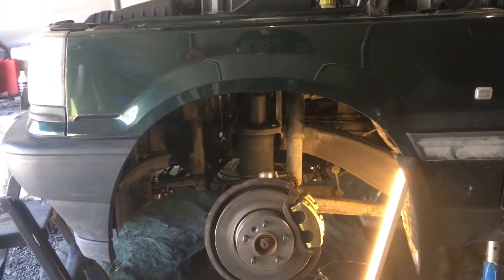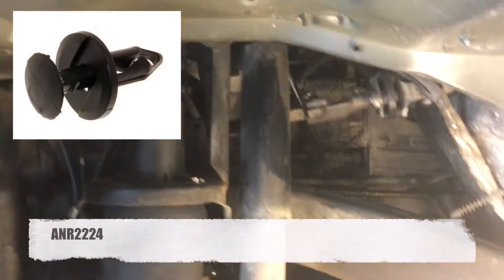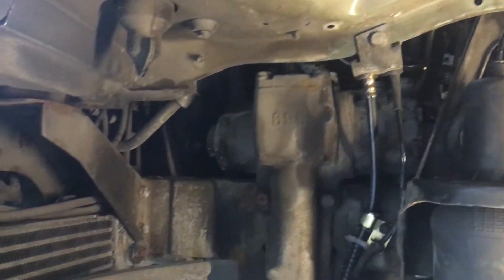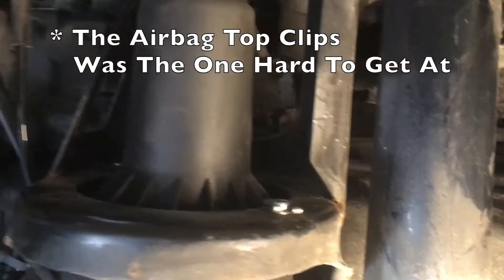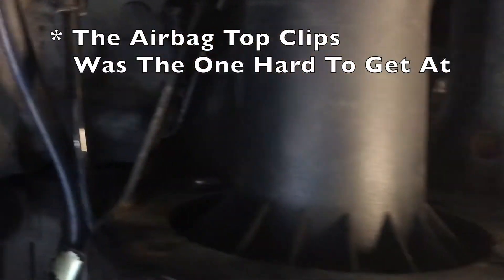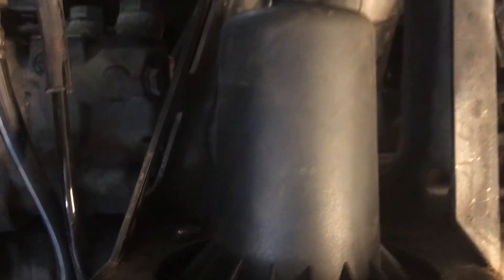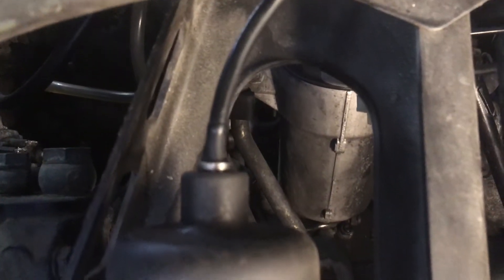As you can see, I took off the wheel lining — the plastic cover. There are just five clips holding it in place. That makes access to the airbag much, much easier and I recommend it. What I had trouble with was getting these clips out and especially back in, especially this one. Those two clips need to be removed before you can remove the airbag. I also had some issues with my air hose on the new airbag, so taking off the wheel liner was really a necessary thing to do.